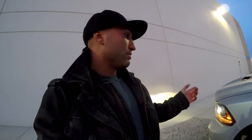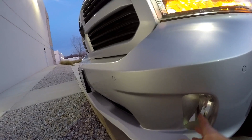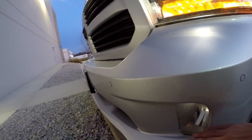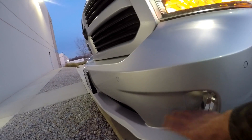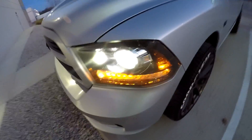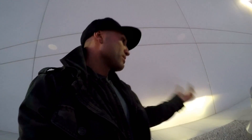For those who don't know, the fog lights on the 2013 and up are vertical — they're 9006 bulbs. The previous generation used horizontal lights with a different bulb, but these are 9006 and the low beams are 9012. You can actually make a 9006 bulb fit into a 9012 socket — you just have to trim the corner tab off to make it fit.